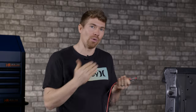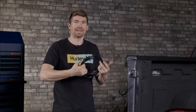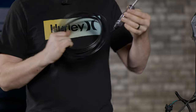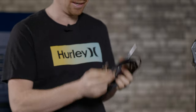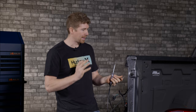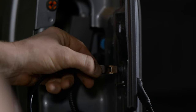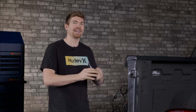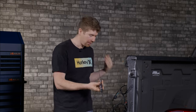A lot of voltmeters out there do get overloaded when you do that, and that's why I would rather choose a test light. You can pick these up for really cheap at AutoZone or even from Amazon. It looks like something like this and it'll light up when it gets power. To use it, put this end on a ground — find a non-painted screw that's connected to the body. Then take the probe and connect it to the power wire, the one that was flashing with the voltmeter.